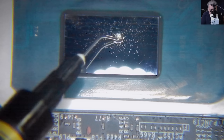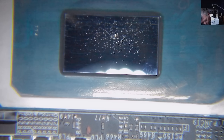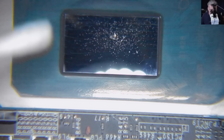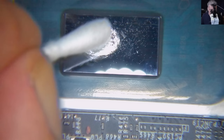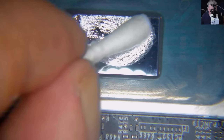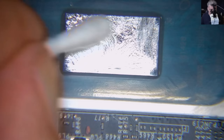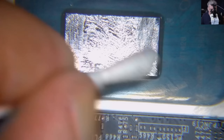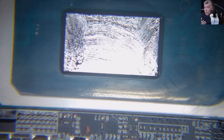That's too much — you don't need that much. You can suck it back. That should be enough. Now use a cotton bud to spread the liquid metal. This is even too much — just to understand how little you need. I'll use the excess on the graphic chip.